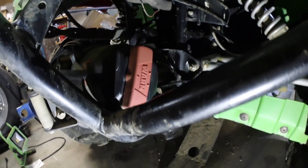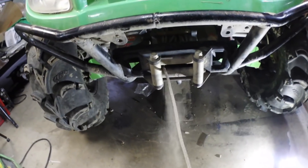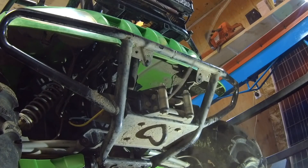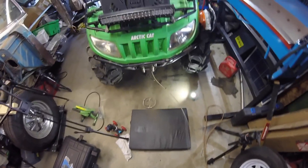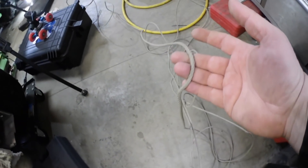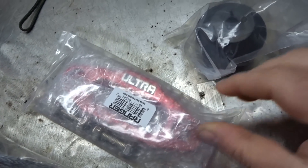It does actually turn into neutral on the winch itself — there's a switch right there. Theoretically this is gonna come up but it's not gonna be pretty. Here's the cable and you can see it's got a bunch of sharp kinks in it. Here it is — the Ranger, a new fairlead, and a rubber stopper. Synthetic rope is a lot safer, especially when it snaps.